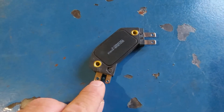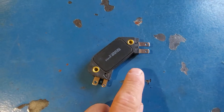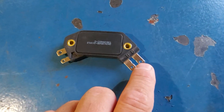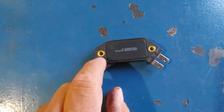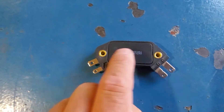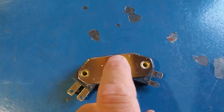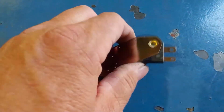On this side you're going to have your W and G pins. The W is your white wire that goes to the pickup coil, and the G pin is the green wire that goes to the pickup coil. On this side you're going to have power — the B, battery power, 12 volts to power the module. This C pin is your coil negative, your trigger pin that basically triggers your coil to fire over and over again. You need to ground your module — these little holes are for mounting the module to metal to ground it, and also to keep it cool using the metal as a heat sink. You'll also want to add that white heat sink compound to keep these modules nice and cool because they do run quite hot.